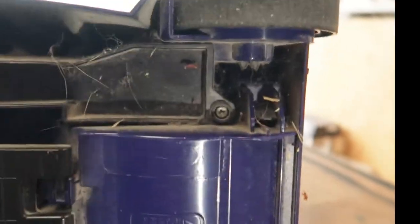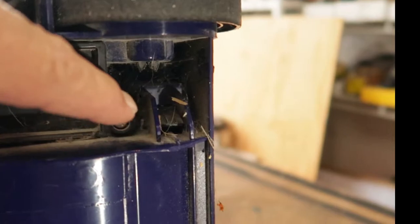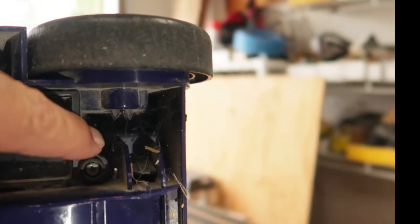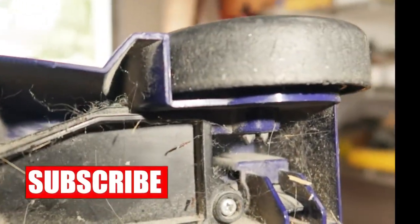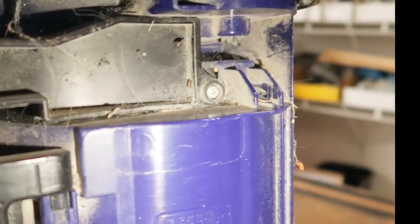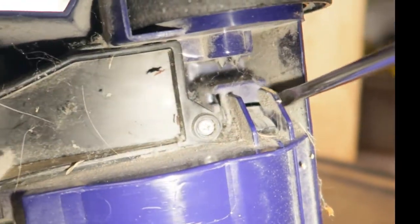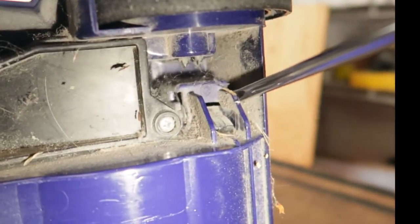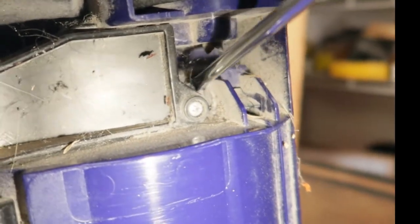The first thing we're going to do is turn this over to its back and you'll see right here — this is the latch that actually keeps this thing in place. Inside of here, if you can see past all those cobwebs, there's two plastic retainer clips. Right on the side here — there's a plastic retainer right here and then there's another one on this side. What I want to do is put a screwdriver on both of those and pry them open. I don't want to do it too hard because it'll break these little clips inside.